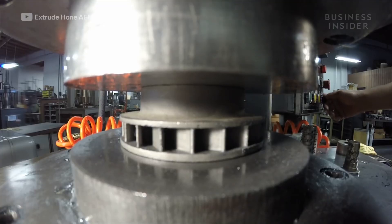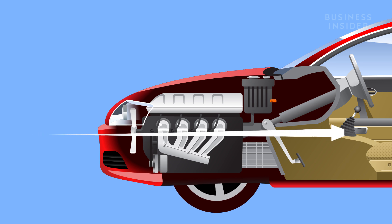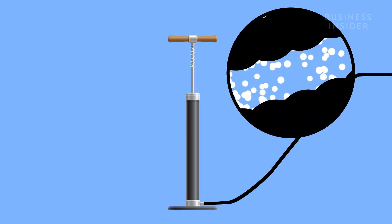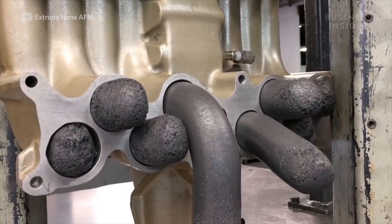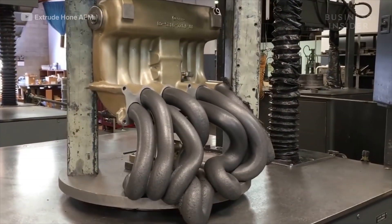The results will vary depending on the part. If you're starting from scratch with a rough, unshaped ported head, the improvements can be drastic. But depending on how much power you're adding to your vehicle, increasing the airflow may not be enough. The engine in its basic form is an air pump — if we have an increased volume of air coming in, we have to be able to reject the spent gases out. If you have a very large intake but a smaller exhaust diameter, it can actually choke the engine. So if you notice your car losing power over time, you may not need that new fancy turbo to reclaim your speed.